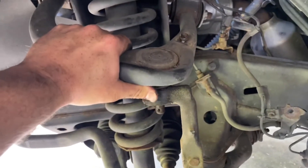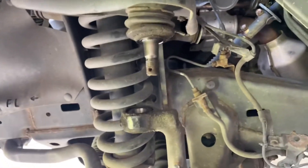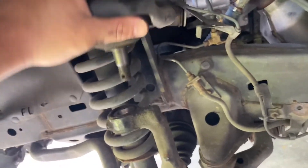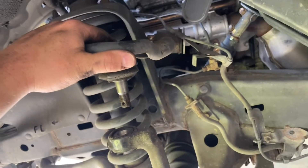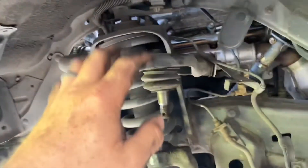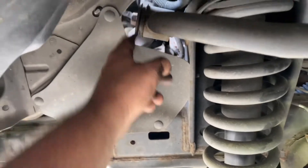We're getting rid of this control arm completely, so get that spindle loose with a few quick taps — took about three or four swings and she came out. There's your ball joint and there's your stock upper control arm. You can see it sprung up because it's been torqued — that's by design to control travel and protect your shock. Next, use 19 millimeter on both ends of the long frame bolt. Loosen it, get the nut off, then work that bolt through all the way. There's a washer in the way so it'll come out a little at a time, but once the nut is off the control arm should be free.